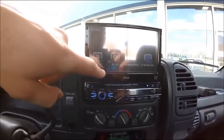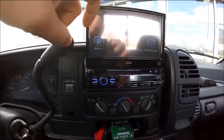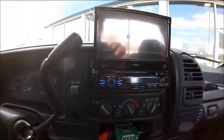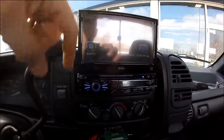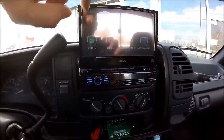I can go right to disc and play a movie on there. A lot of these radios are set up so that you have to link it to a parking brake - you gotta put the parking brake on, off, and then on again and then it'll work. Well, I just ran that wire right to a ground and it works all the time.